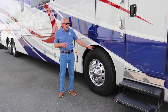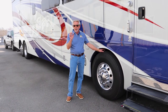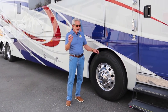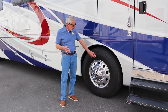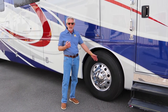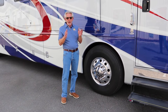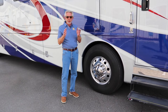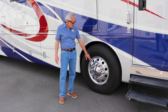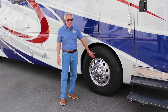You're looking for any damage to the tire. A real good tip is to get down behind the motorhome and look between your dual wheels. I do this every single time I go to a rest stop, because you may develop a bubble on the sidewall from damage you ran over that you are not going to see from the outside. Look between your dual wheels and make sure you don't have any sidewall bubbles or obstructions you picked up from the road. Check for cracks in the rims, any damage to the rims, or maybe a loose wheel nut — just something you want to visually check.